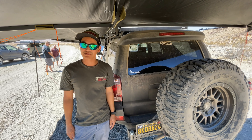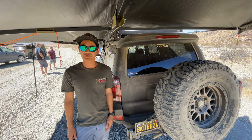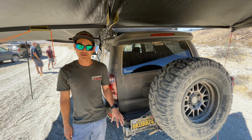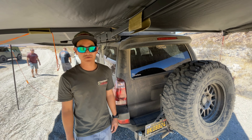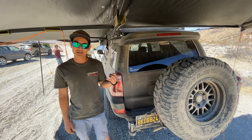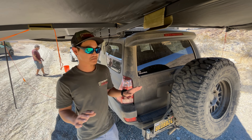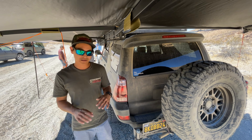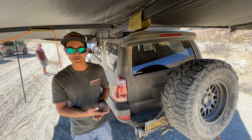We've been off-roading for years — 10 years with mostly 4Runners, first, second, and third gens. For a long time I didn't have to lift them; I just put on a decent set of tires and that's all you really need as far as the vehicle itself, plus proper maintenance. Some vehicles have weaker parts than others — first gen Tacomas and third gen 4Runners are notorious for ball joint failures that happen out of nowhere. I've had it happen to me: I was stuck in the snow on a trail overnight, unprepared, no sleeping bag, freezing, and had to wait for park rangers to come up so I could fix the ball joint in the snow the next morning.